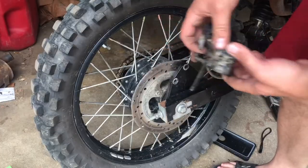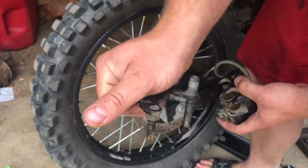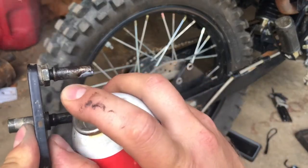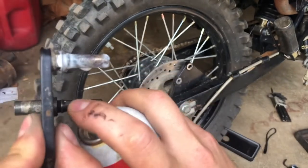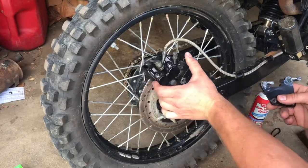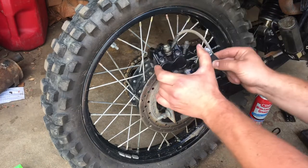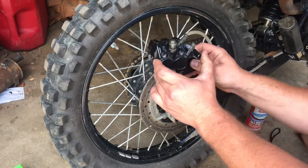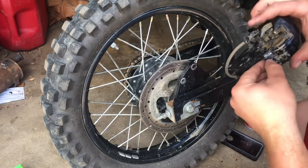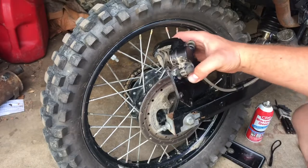While we're at it, it's a good time to do maintenance on the brake caliper. You're going to pull this thing straight out — it's just two pins. You want to re-grease these pins. I've got some white lithium grease here — any grease will work. When you put this back together, the brake caliper goes on like this; you want to have your bracket in this position and just slip it right back into those holes. Make sure your seals are back in place. Sliders are all lubed up, and now it's time for the new brake pads.